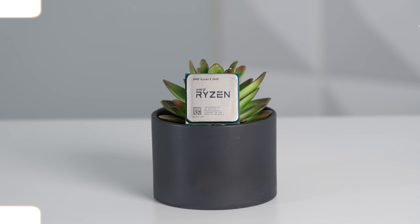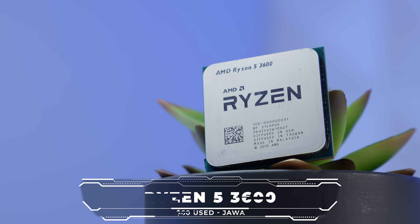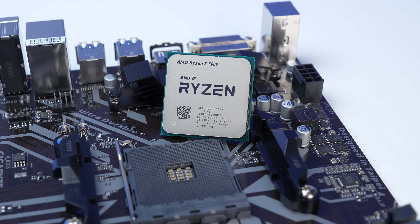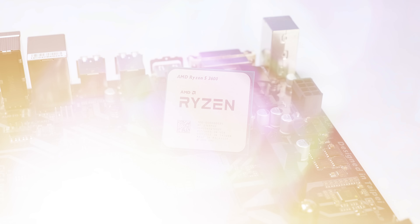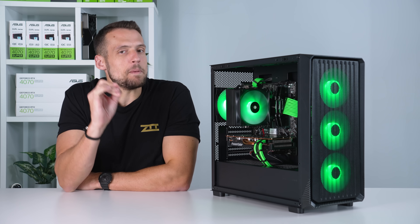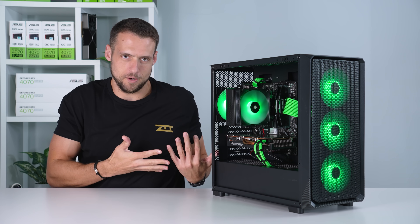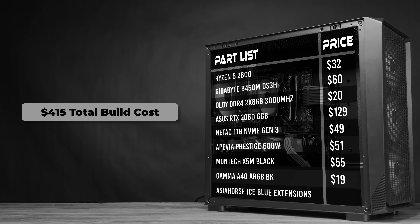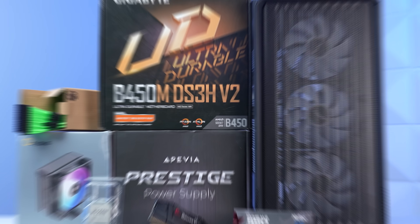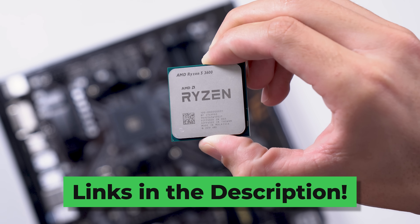Starting with the CPU, here's where I'm definitely focusing on improving from last time. This is the Ryzen 5 3600, and believe it or not, that's actually a pretty beefy upgrade coming from the 2600 from the previous build. It's still six cores and 12 threads and just one generation newer, but that architecture improvement was pretty substantial. I did have to spend a few more bucks to get it though, and you'll notice throughout this video that is kind of the theme of the build. The prices from the last $400 video were all somewhat fair and normal, but we are just a bit more expensive this time. I'll have links to every part down in the description.